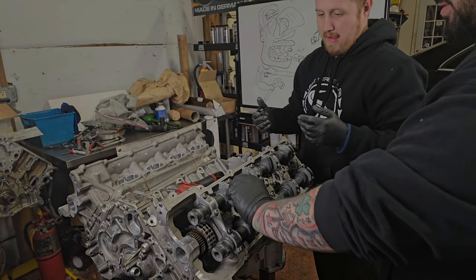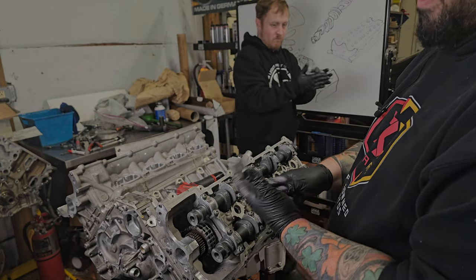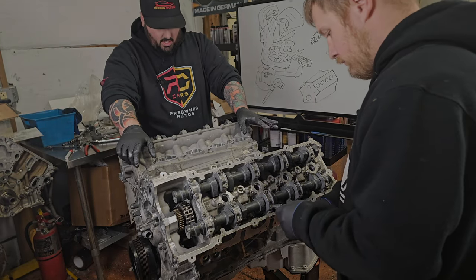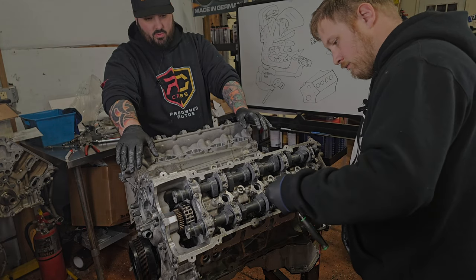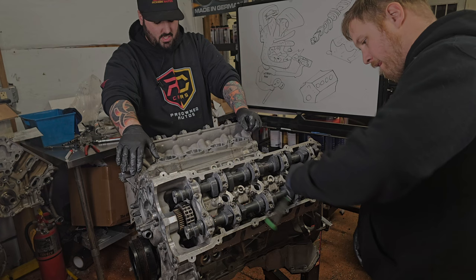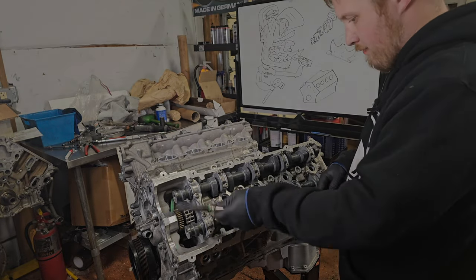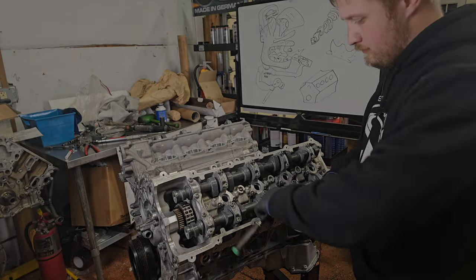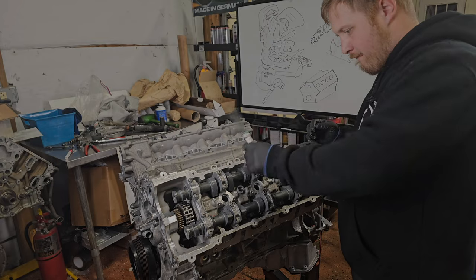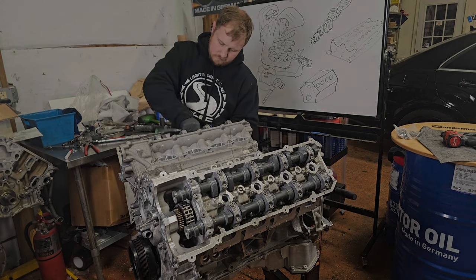When you use factory cam caps with aftermarket camshafts or a different cylinder head, you may run into some binding. So you'll take the cam cap off, polish it, refit it, and then all will be well. Now we're slowly working the cam caps down until they're fully seated. We'll back the cam bolts out one at a time to put the titanium ones in. If you have the factory bolts, use those to run the cams down, then swap them out and torque them.